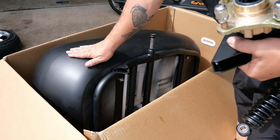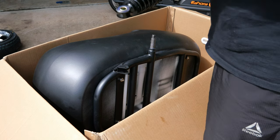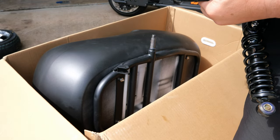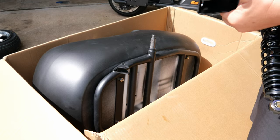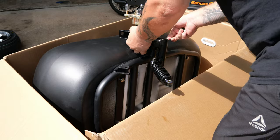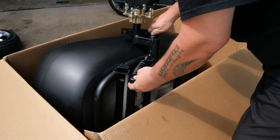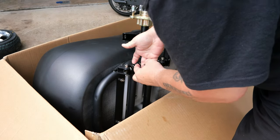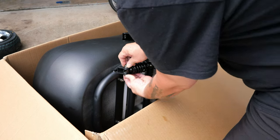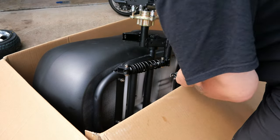The instructional video will tell you to put this sidecar onto the M1 PS first. However, I'm going to put the side wheel on first. The reason is I want something on this side to support it while I'm putting it on there, so it doesn't pull on the motorcycle. So you've got the big side that goes here onto this axle. The axle is greased, so be careful with that. We'll tighten that down here in just a minute, and then we'll put the nut on the end and tighten these guys up. So far I've done everything with the tools provided — this is a 17 millimeter.